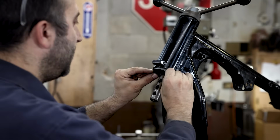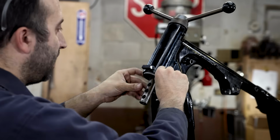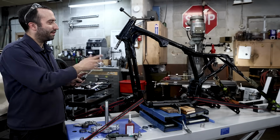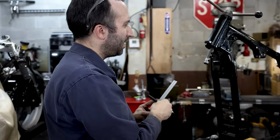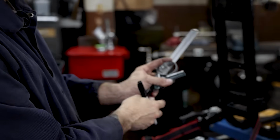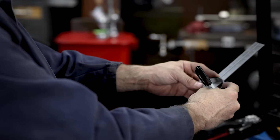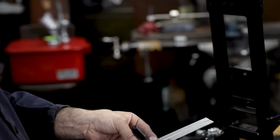And so from the front, the tang is basically the width of the shaft on the tool. So if you can't see the tang, you're pretty dang straight. This is a little hard to line up, and since we're putting the tang in the back, it's hard to see. But then again, I put it in the back because I wanted to hide a little bit of that grinding and stuff. So to try to line this up, since everything like this is going to be in the way for me to visually see that it's in the center, I'm going to be using my combination square to put a line directly across from the center of the tang. And this is also going to be a little bit of eyeballing. This attachment for your square puts the mark in the center of a circle, which is why it's handy.